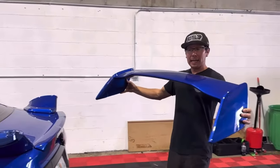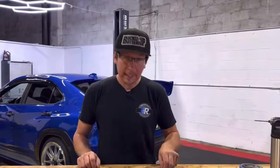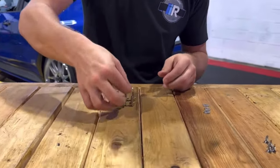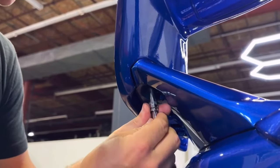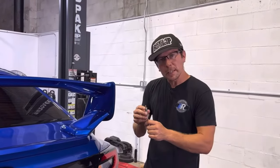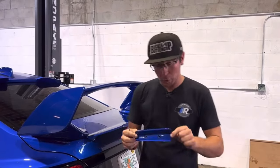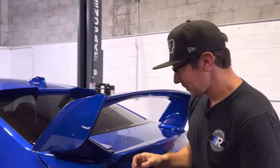With the wing bridge in hand, we can place it on top of our bases, take a washer and add it to each one of our 6 bridge hardware. Then we can install the hardware onto the bridge. We can start installing our 3 per side 10mm bolts into the bridge. Loosely install all 6 pieces of hardware before we tighten everything down. Finally, with all of our bridge hardware installed, we're going to install our bridge hardware cover with the 2 provided self-tapping screws.